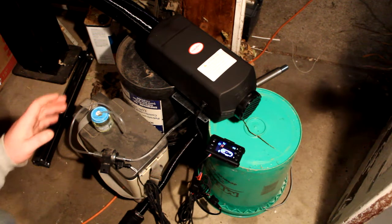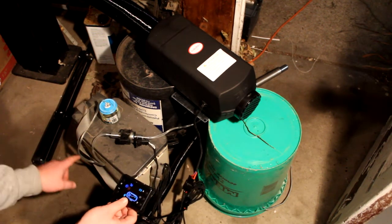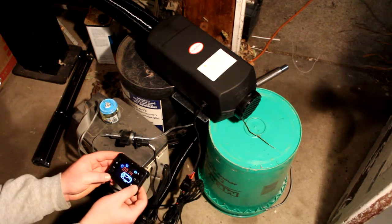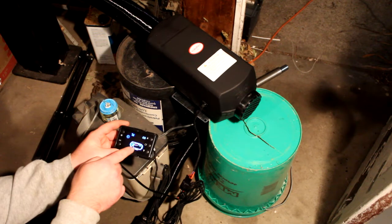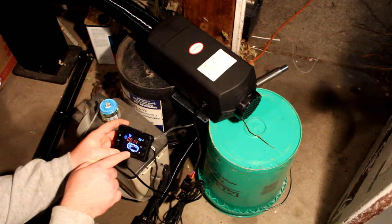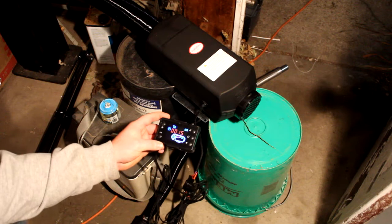So when you first get one of these, you want to pre-prime the pump. But yeah, I just ran temporary fuel line. Okay, seems like it's shut off. So now I'm going to power it on, see if we get ignition. Fan starts spinning, you see the glow plug light turn on. See the exhaust ports lighten up. Well, the startup process can take a while, they say.